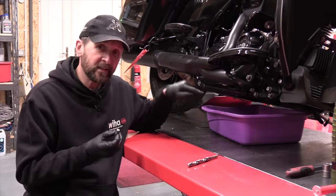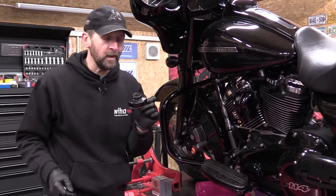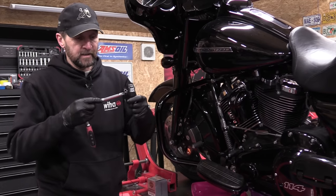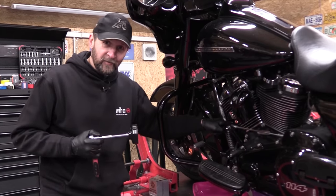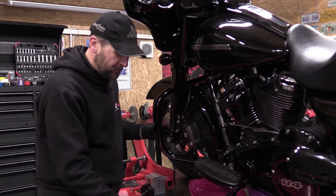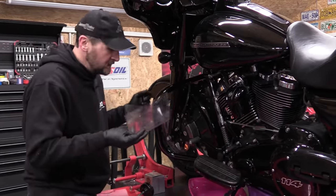While we let the rest of the oil drain, we'll change the oil filter. The best thing to undo the filter with is a filter wrench — you can get these from your Harley-Davidson dealer; it has a part number listed in your handbook, so there's no excuse not to use the right one. It's just a little cap that goes over your filter and undoes it, taking a 3/8 extension bar. The filter lives at the front of the engine, and as you undo it, oil will pour out from the joint. Use a piece of cellophane — or anything slightly waterproof like a magazine cover — and tuck it in to catch the oil.